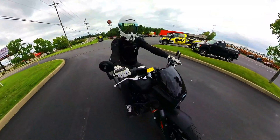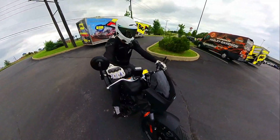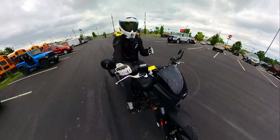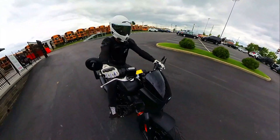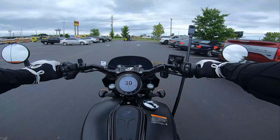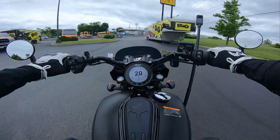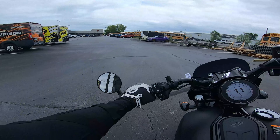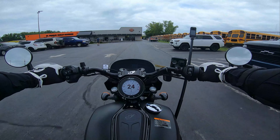Our test ride segments take place at Big St. Charles Motorsports and Big St. Charles Harley-Davidson. Prior to getting out on actual roadways with the Indian Scout, we're going to do what every rider should with a brand-new motorcycle — get acquainted with it at low speed first. Get acquainted with your brakes, the friction zone and the clutch, just learn the bike for at least five minutes before hitting the road. We're going to ramp it up to 30 miles per hour and then jam on the brakes to figure out where they like to bite.